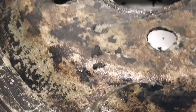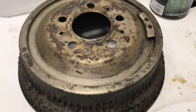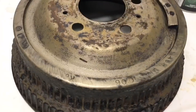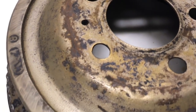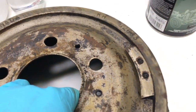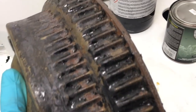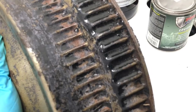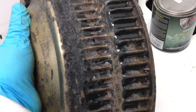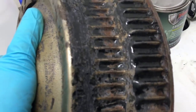This is what it comes out like. Some of those loose pieces I'll remove because they were already coming off. I've now removed most of it, and as you can see, there is some rust. The trickiest part was getting the paint out of all the grooves down here. I'm going to use a wire brush to remove the last parts, because I don't want any polyurethane paint left there when I powder coat it. The remains of the previous primer I'm not so worried about.